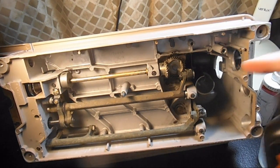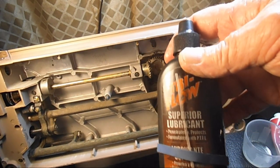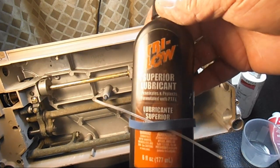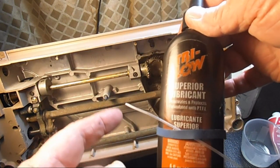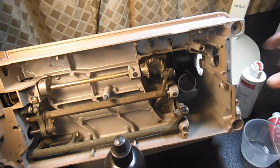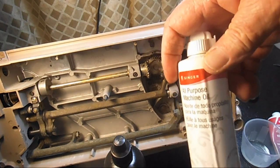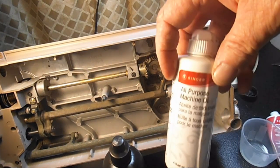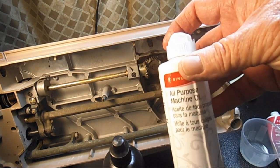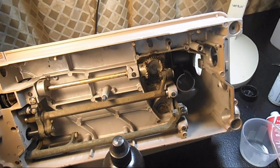There's nothing wrong with all-purpose machine oil from Singer and Lily sewing oil, like a lot of industrial shops buy in big bottles. The purer the oil, the better — you don't want additives, because that's what gets dried and varnishes. So what I would do is start with the Tri-Flow and get some especially into those bearings and bushings. Remember, I pumped cleaner in there and we've had water in there. So I want to over-oil this time and get it full of oil. For maintenance you put like a drop once a week, but since we've stripped everything, we need to really fill it up.